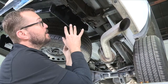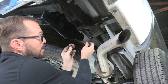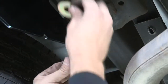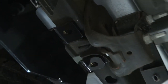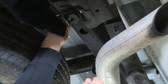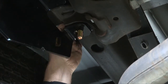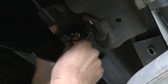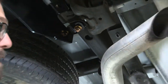With my hitch being temporarily suspended by the factory hardware I just installed, we're going to install these large round washer spacers between the hitch and the frame rail of our GMC. Next, we'll install our carriage bolts and retainer blocks from the inside down through the frame rail, then through the spacer and hitch, and lastly install the flange nuts just by hand for now. We'll snug everything up once we get all of this hardware in, both passenger and driver side.